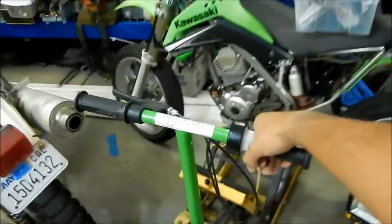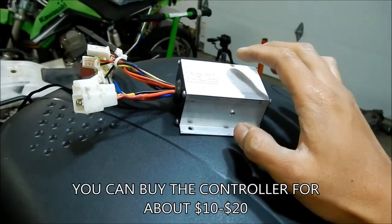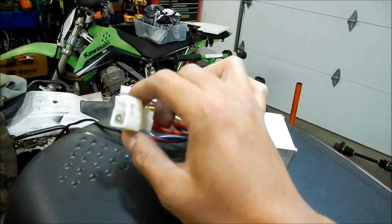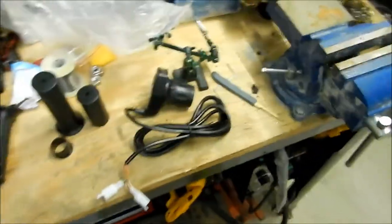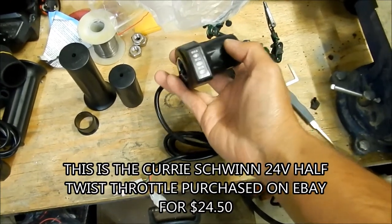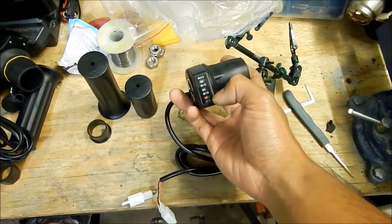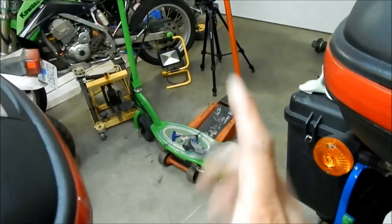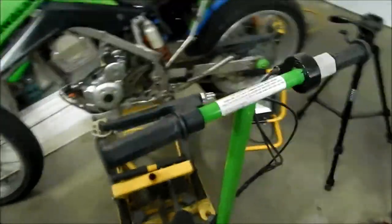The advantage of this is I can use a new twist throttle that has variable throttle - not the zero to one hundred like I mentioned. I already have this one and it probably costs less than twenty bucks. They sell actual upgrade kits on eBay and scooter stores too, but I'm using the one from my electric bicycle since I noticed a lot of the connections are the same and they're already labeled. The new twist throttle is - I think it's called Currie tech or something similar - and it's a half throttle with a little indicator light showing your battery level.